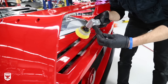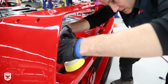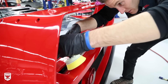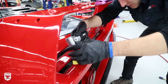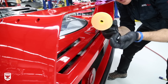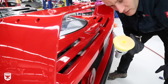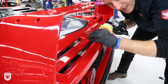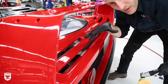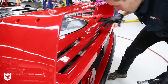The rotary comes with a little handle but I like to take it off. So I get right on top, find a very exact line, and match the slope of the vent. Because this is rotary, it's not going to oscillate or bang into the sides the way a random orbital would. Rotaries aren't evil - they're great in tight little areas like this where you can't allow the oscillation. So that's just a few things to think about when using different machines, which is why I have so many.